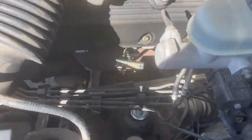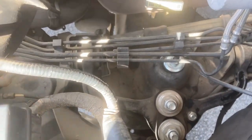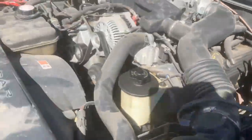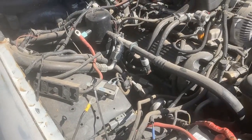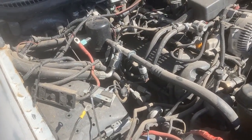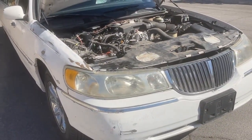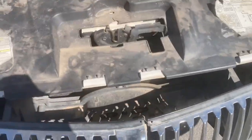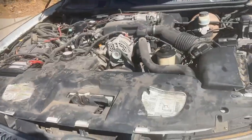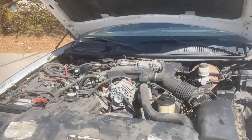The front end was rebuilt — you can see that's definitely not factory equipment. They did an okay job. It needs an alignment front and back, needs rear brakes, and I'm sure the parking brake doesn't hold the vehicle that well. Oh, and this part is cracked. The horn doesn't work — if I trigger the security system it will honk, but the actual button doesn't even move. So that's pretty much everything wrong with my 1998 Lincoln Town Car. That's episode one.